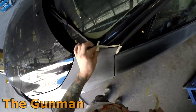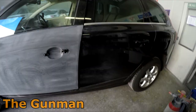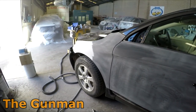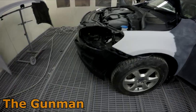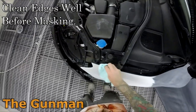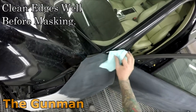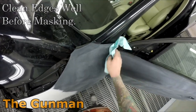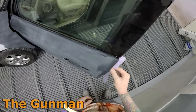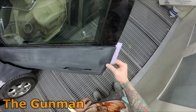When I first started dry sanding, I'd scotch it over my primed areas and then use that same bit of scotchy over the blend areas, and little bits of dust from that primer, your light grey primer, would get stuck in the piece of Scotch-Brite. And then when you go and do your blend area, where you're only going to be putting colour, you'll actually get a bit of contamination, and you can run the risk of clearing over this murky, cloudy looking primer dust. So something to be extremely careful of.